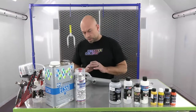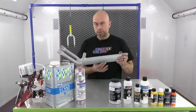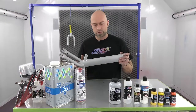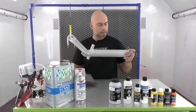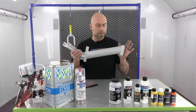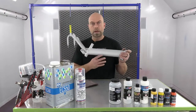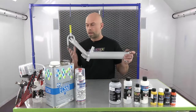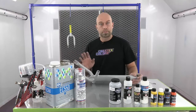To start, it's an aluminum frame. We're going to prep everything. Because it is brand new, right out of the box, we just pulled off the decals, cleaned it with a little bit of wax and grease remover, and gave it a light scuff with a red scotch brite pad - that's all it needed. Maybe a few little nicks in the finish we can feather out. It's 320, about the equivalent of a red scotch brite pad, and our silver sealer is going to cover that 320 scratch perfectly.